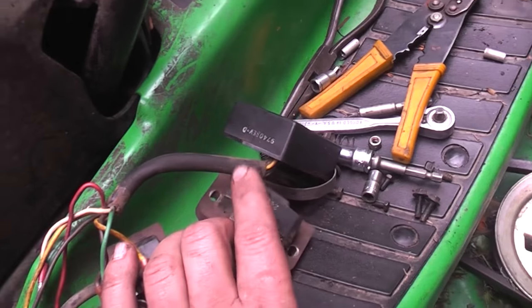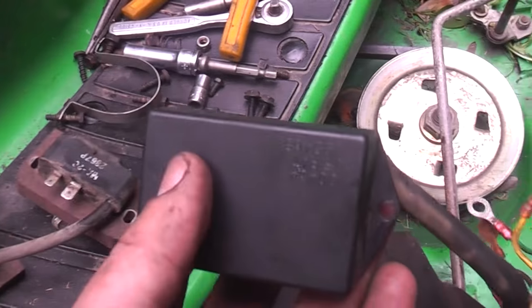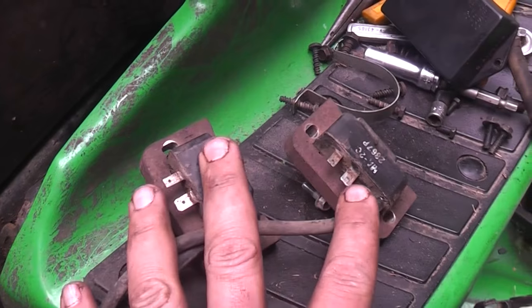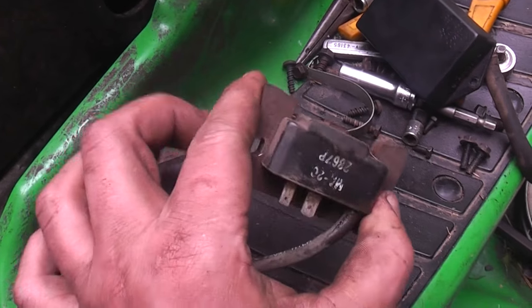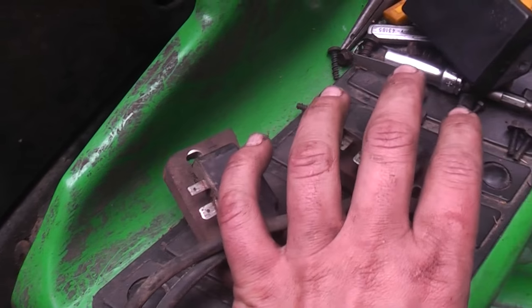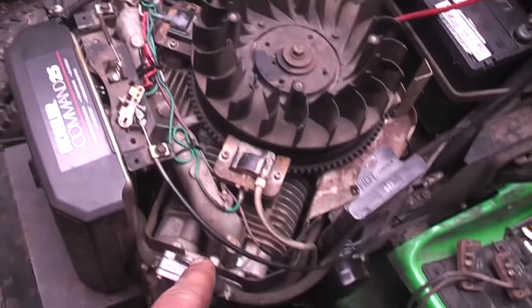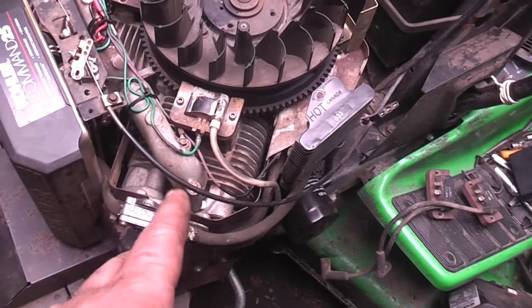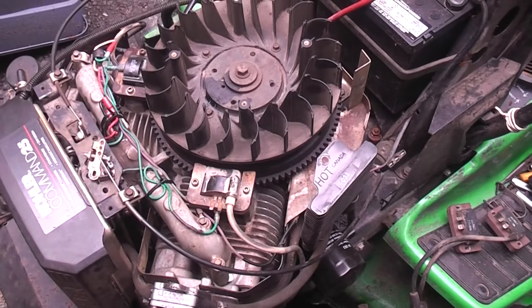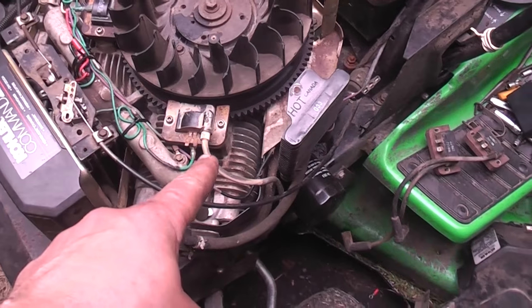Some of these Kohlers had a smart spark or some kind of ignition advance module. That has to tie in with the two modules. One of these I think is broken down and had a weak spark, because it would run fine on one side — really well on the side that I fixed the head gasket on — but the other side was intermittent and it couldn't take heavy throttle. You had to ease the throttle up to get any advancement and for it to run on that side. So isolated to the one coil being bad.